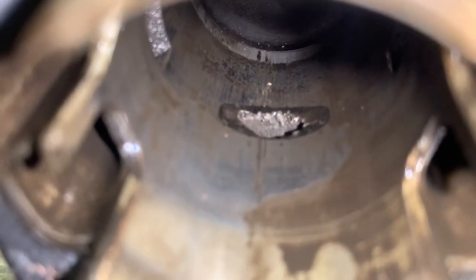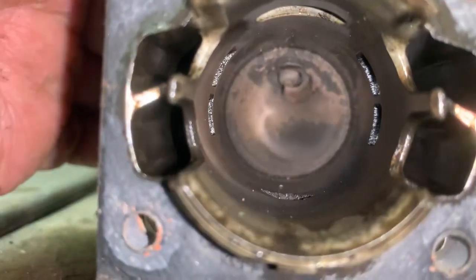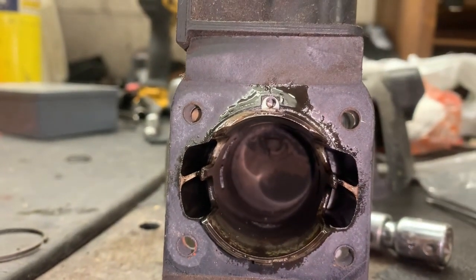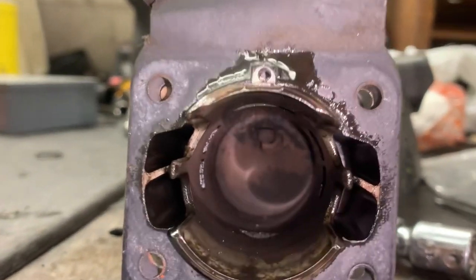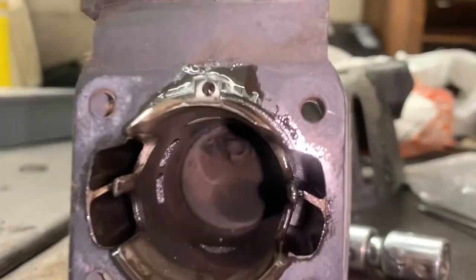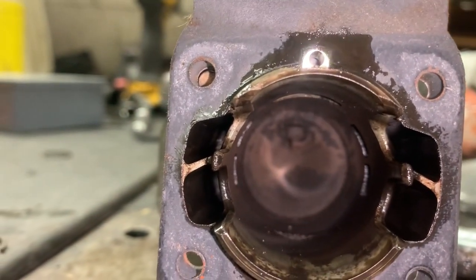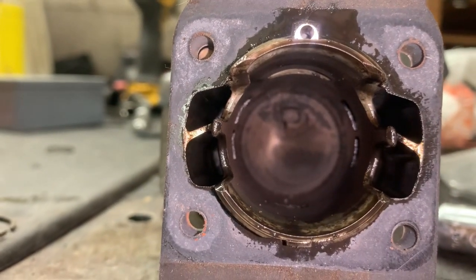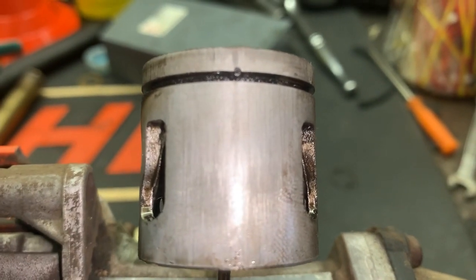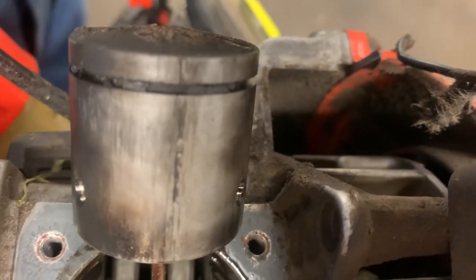You can see the outline of the carbon, and that carbon buildup, when it starts to build up, it starts to scrub on the piston skirt and just wreaks havoc on the rest of the engine. As it starts flinging off carbon bits and gets down in the bearings, it just wears a groove in the piston — literally wears out the engine like liquid sandpaper. The intake side of this piston is scuffed pretty heavy, and on the exhaust side we've got some pretty deep lacerations.